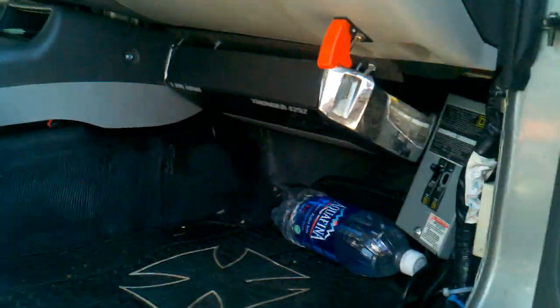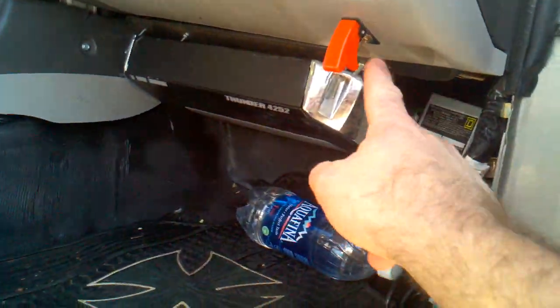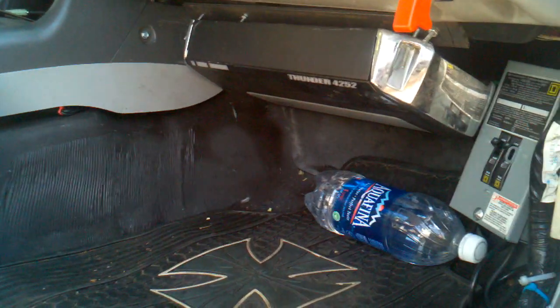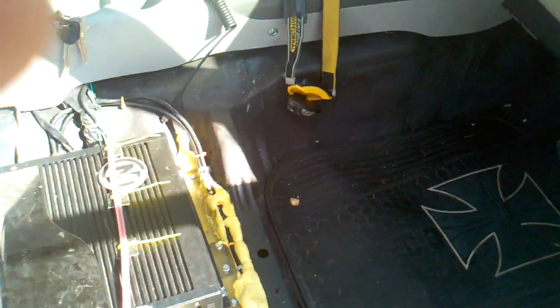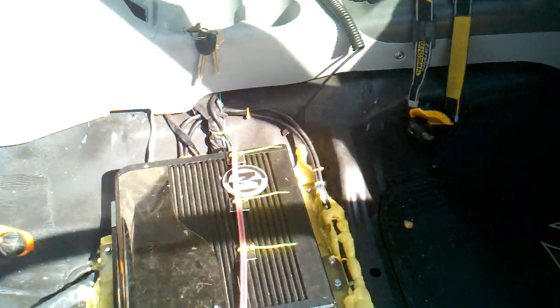The hardest part was getting it through all the doors. What I thought was kind of cool is this remote switch — the remote goes to both amps, run in parallel. My head unit uses a 5 volt signal. If you choose to have an amp cutoff switch using the remote and wire it in series, it will divide the voltage across the 2 amplifiers, and that will probably cause them not to get the full 5 volt signal needed to turn on. So do run your remotes in parallel.